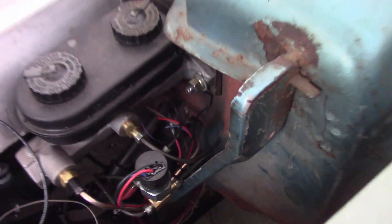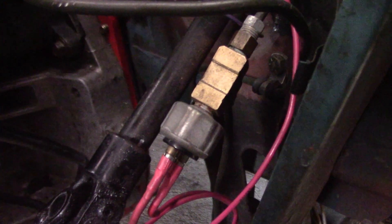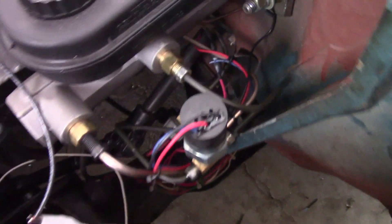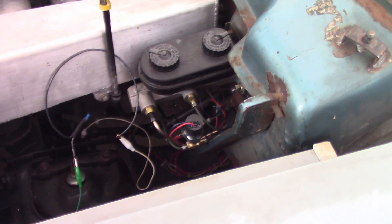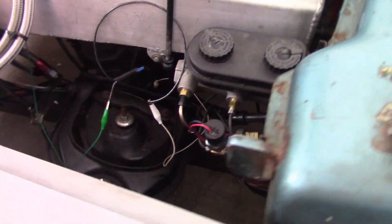It doesn't look like a regular brake switch. The reason for that is this one is adjustable — you can see a little hole and there's a little allen screw in there. The reason I didn't go with a pressure switch like the one that activates my brake lights is because this is a much higher pressure switch. So I basically have to be really on the brake pedal, which you should be when you're trying to spool up the car on the line.